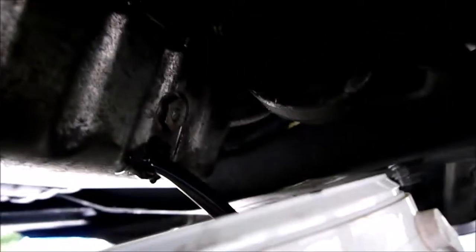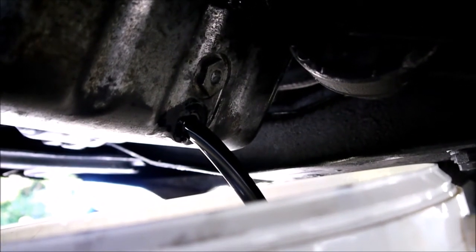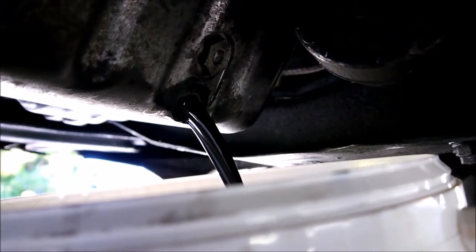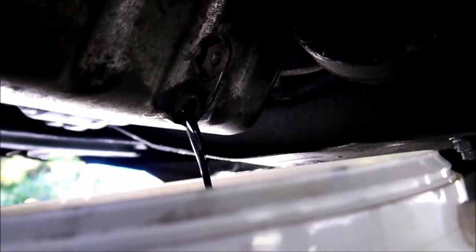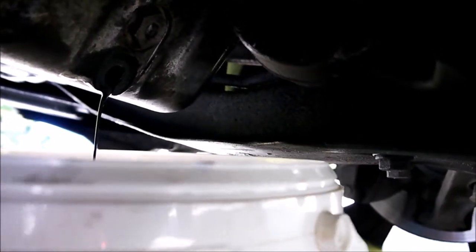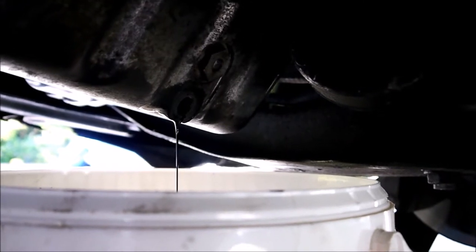You can see the oil is nicely flowing out of the engine — nice and hot. Be careful you don't burn your fingers on it because the engine is still warm. It's also worth noting, if you've got a small bucket to catch the oil — this bucket is quite big, which I use to collect waste oil. The angle that the oil pours out at will vary, so sometimes it may trickle down the side of the sump and pour off in various places. You may have to relocate the bucket to catch it. I'm now going to get out from under the car, let the rest of the oil drain, and show you how to change the oil filter while the dregs drain out.